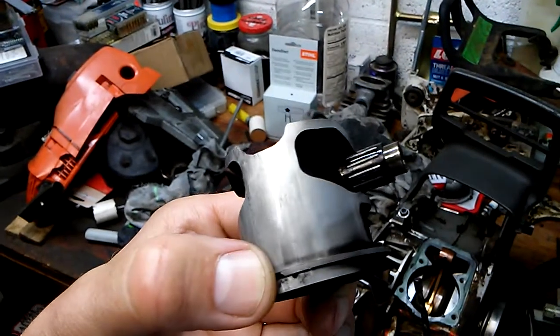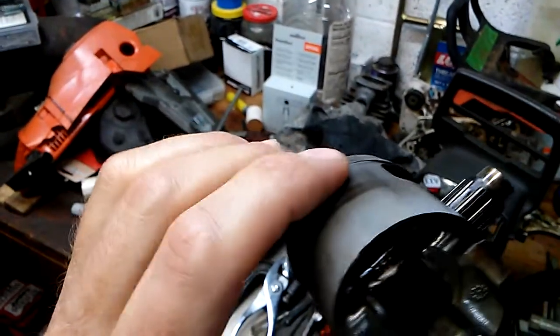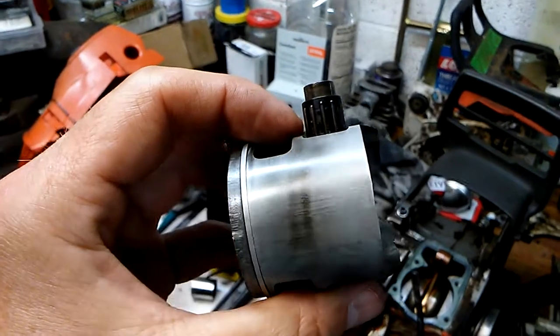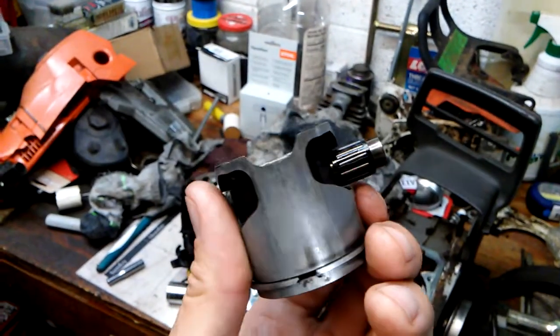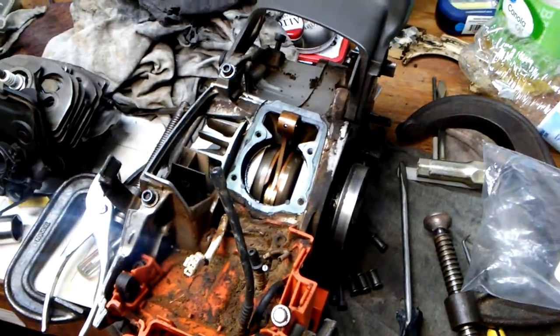This is the intake side where that trash was coming in. The exhaust side, there was very little. We have that ghosting phenomenon that's talked about some, but very little scoring, if any. So the scoring came on the intake side where the trash was coming in, and obviously if it went in the intake, it went in the crankshaft and crank bearings.